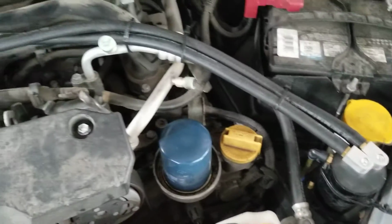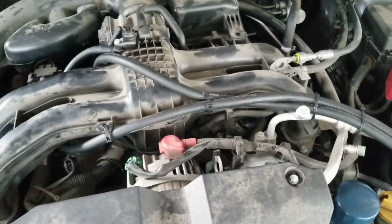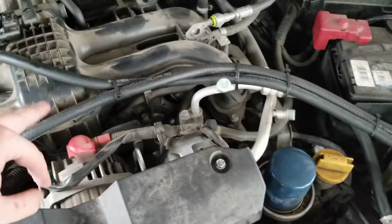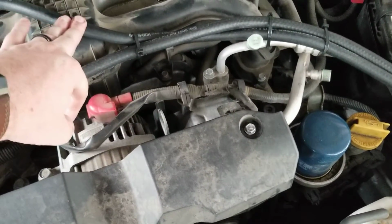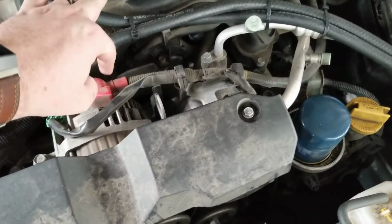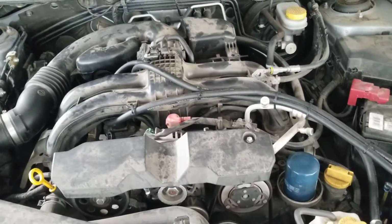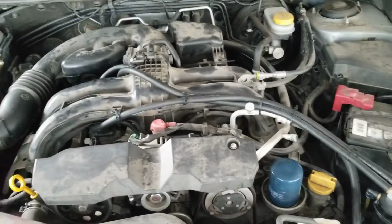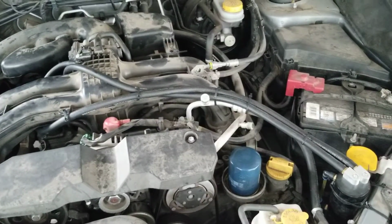One thing I did hate though, especially on these eBay specials, is the tubing that comes with it is absolute junk. Now this is 3/8 Gates tubing, automotive, specifically PCV, positive crankcase tubing. I think I got a spool of like 50 feet of it for like $20. For some reason, auto stores don't have that much, and for what I wanted, it was fairly cheap. I have enough, if I have another car or want to reroute it.